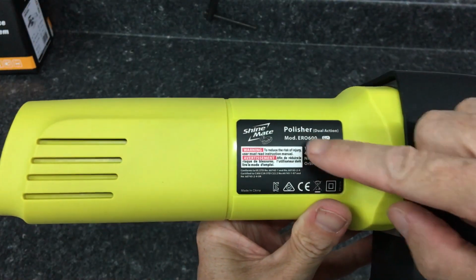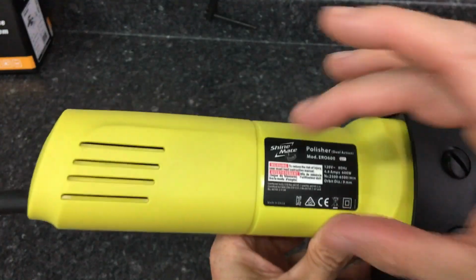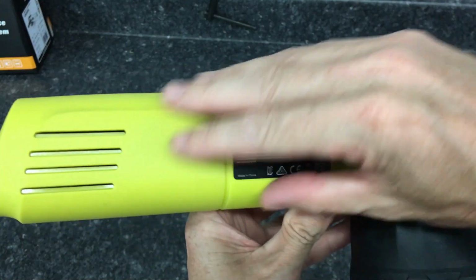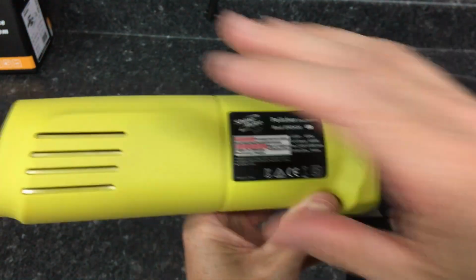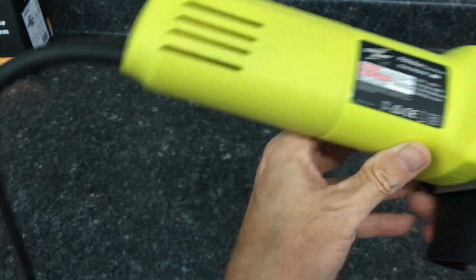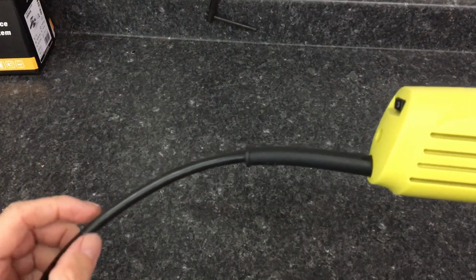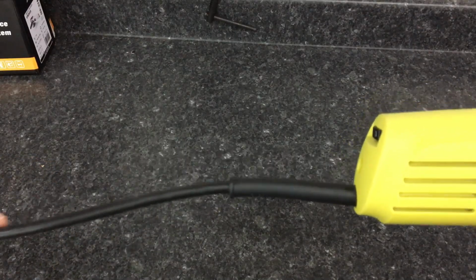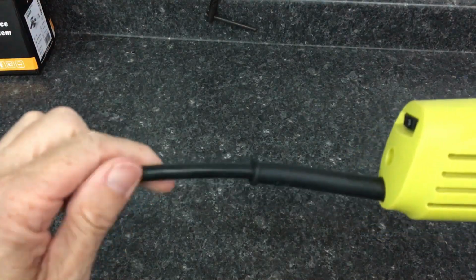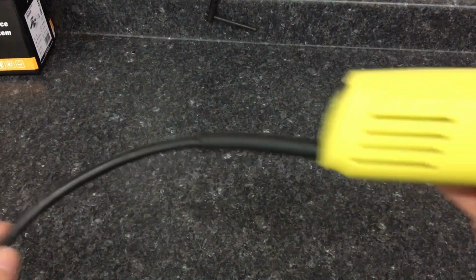Here you'll find the model number, the ER0600. It quite simply translates to a 600-watt motor, and that is placed on top of a PA6 GF30 plastic encasement, which just simply means it's nylon that's reinforced with 30% fibers. And that leads to our power cord, which is a rather impressive 16 feet, but it's an SJT, junior service, quite common on the entry-level polisher. And the T means thermal, so it's that hard, stiff plastic instead of the nice, soft, rubbery cords.